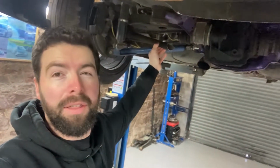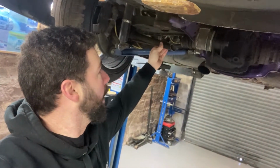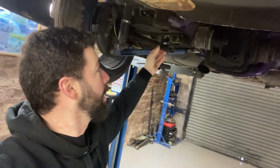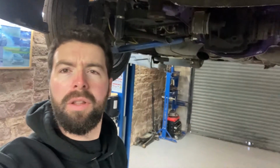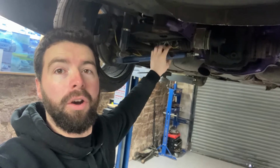I've had some issues, you might see in the back there. Been snapping shafts. So this one here is a 330 petrol one. They are like chocolate. That snapped and didn't do a clutch kick or anything. I just pressed the throttle and it snapped. But I've been using 320 diesel stuff. The actual shaft, nothing wrong with the shafts in the 320 ones because they're not hollow.